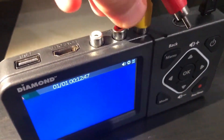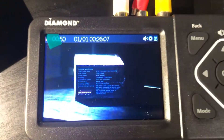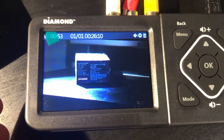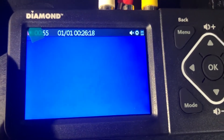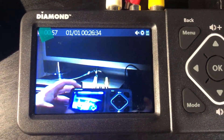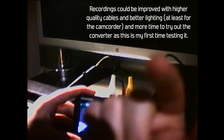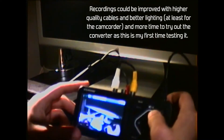The camera is off at this point but we have everything plugged in, and as soon as we turn on the camera we should see an image. Now we have an image. Whenever the video cuts out it also pauses the recording but doesn't completely stop it — so that's extremely handy if you have something that cuts out on tape but there's still more content left. Now we are actually recording directly from the VHS camcorder — the audio is off to avoid a feedback loop — but we are recording directly from composite mono audio.